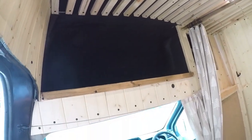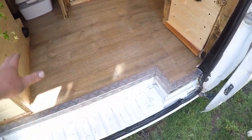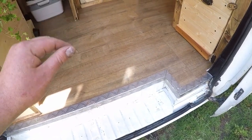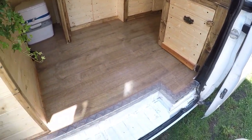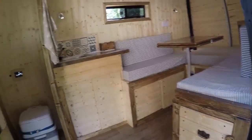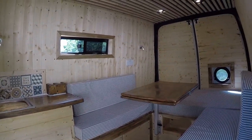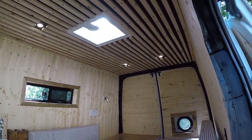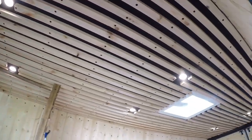We've also got the bulkhead storage up here which is lined with 12mm insulation. On the floor underneath the subfloor we've got a loose fill vermiculite insulation underneath, with board on top of that, then another layer of 6mm insulation, and then the laminate flooring. Along the sides that's all filled with recycled plastic bottle insulation, as thick as it can get. And in the roof there's 25mm insulation and 25mm panels, covered with a layer of ply and then the battens.